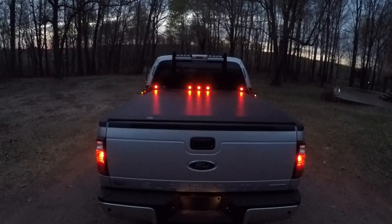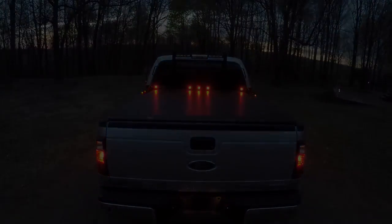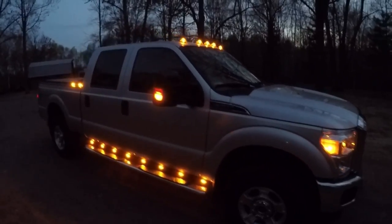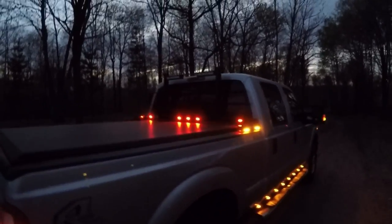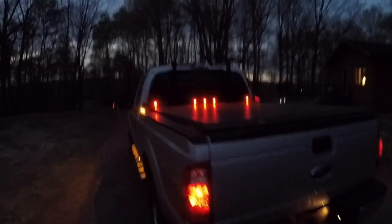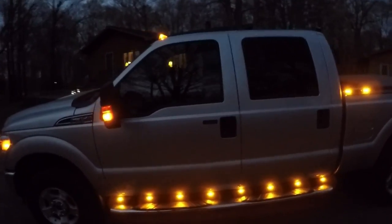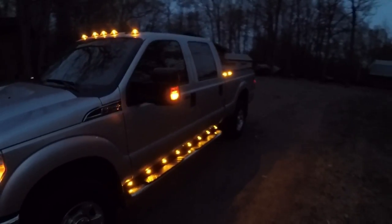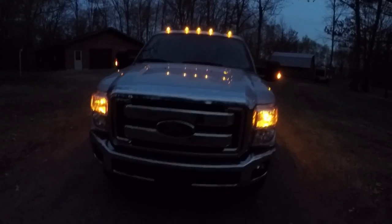So that's the full rundown on all the lights I put on the 2016 Ford F-350. Started out with those cab lights up top, then did those lights down below the doors, then moved on to the back rack. I like how I was able to wire everything into those upfitter switches and that round rocker switch, so if I don't want this many lights on I just don't flip that many switches. If I only want the red ones on the back, just flip up aux 4. If I only want the amber ones on the side, flip up aux 3. Kind of like the versatility of it. Guys, it's getting dark — thanks for watching, like, subscribe, leave comments below, and I hope to see you back again.